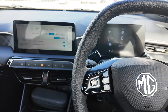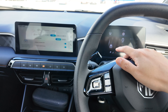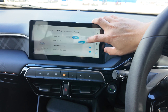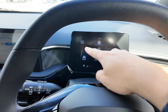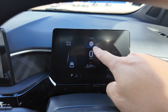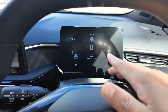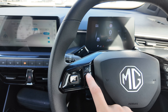In this instance, you're still driving the vehicle yourself — you brake, you accelerate — but the vehicle does not allow you to go over a certain limit. There is one scenario where you can exceed the limit momentarily: by pressing the accelerator pedal all the way. That allows you to override the speed limiter momentarily before you release the pedal again, and then it will bring you back to the set speed limit.